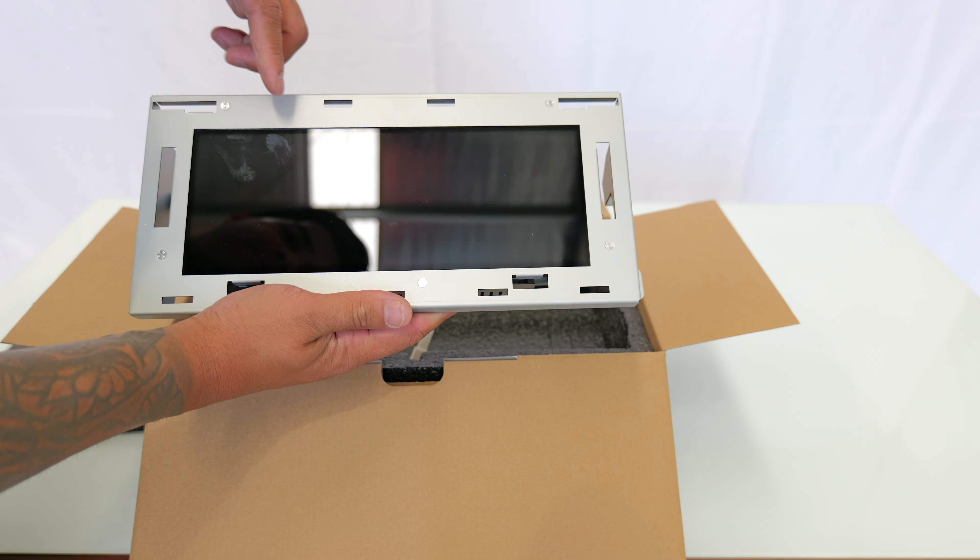After that front panel comes out, this little rubber piece comes off — there are two screws, usually seven or eight mil. Someone's had this out already because one is a Phillips head and the other looks like an eight mil. Take those out, then get this panel out so the silver trims come out, giving us access to the front side silver trims. We're taking that rear section out to give us access to pull these up and out.